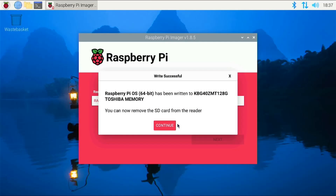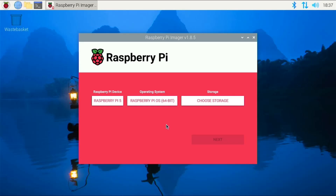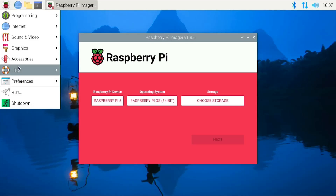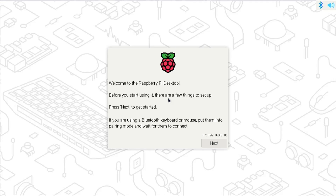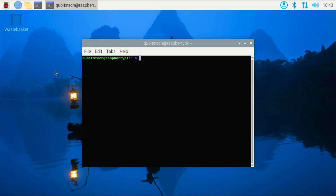Skipping ahead a few minutes — it took about 3 to 4 minutes to install. Now we're ready to reboot. I'm going to shut down the Pi first so I can remove the microSD card while it's powered off, to make sure it's definitely booting from the SSD. With the card removed, I'll power it back on. We've now booted into the initial setup for Raspberry Pi OS, confirming the OS was installed correctly. I'll run a couple of basic benchmarks using a tool called HDParm, which needs to be installed in Raspberry Pi OS as it's not included out of the box.